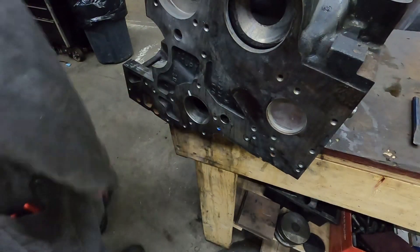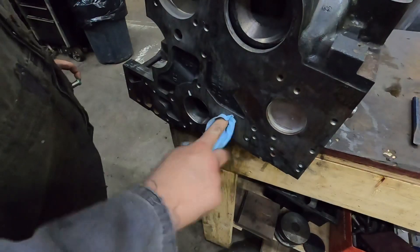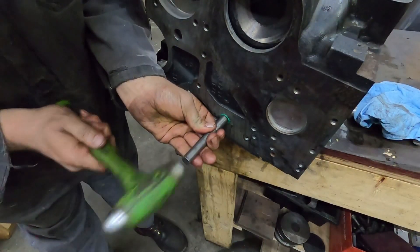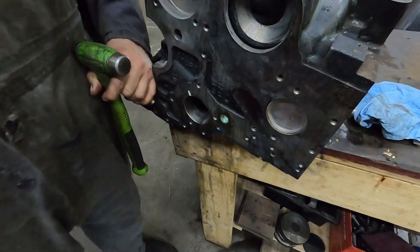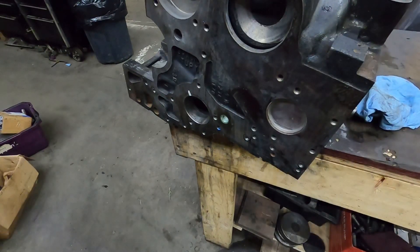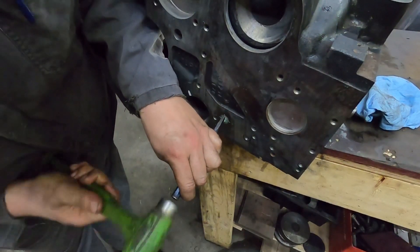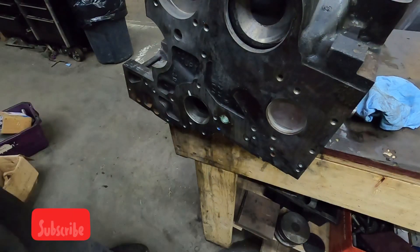You want to make sure that hole is clean inside — you're installing this on a clean block, but make sure it's clean; otherwise you won't have any oil pressure. Stick a rag in there, make sure there's no oil on it, make sure you're straight, and then just tap it in. You want to go just below the surface — you don't want to go in very far because some of these blocks have a cross-drill that you don't want to cover. Afterwards we stake them — you don't need a huge stake — but it gives extra insurance that the frost plug won't pop out, because the stake stops it from doing so.